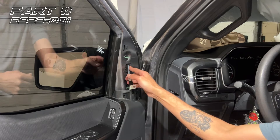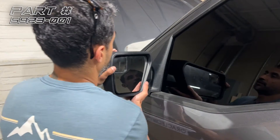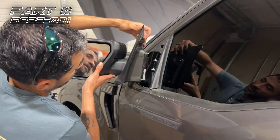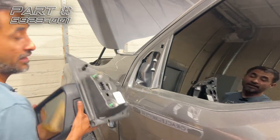Lastly, I'm going to unlatch this plug and pull it off. Then we'll come around to the front side of the mirror and lift up — tilt up and pull down and out, because this hook is inside of the square. And your mirror's off.